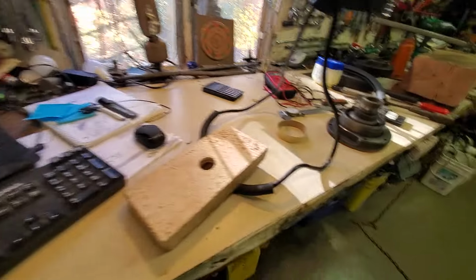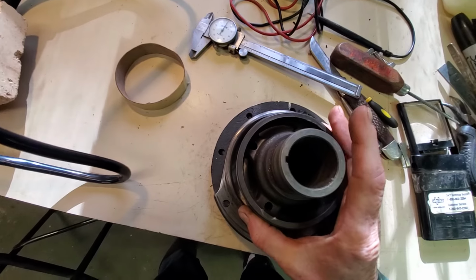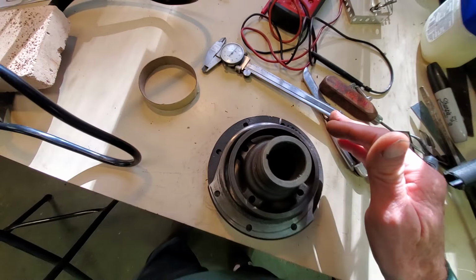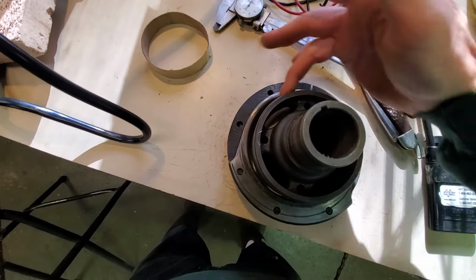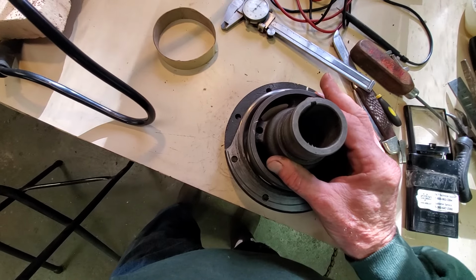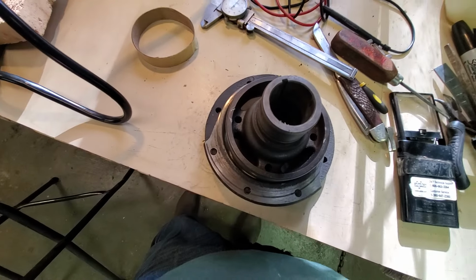Listen, back to our point. So I failed on my first video because of the radiator hose, but I did talk to Damper Dudes. They seem to know everything technical about harmonic balancers and dampeners. And I told them I was getting a gap measurement around the inner hub to the outer inertia ring of 0.100, and they confirmed, yep. They clock the inner hub to the outer ring, set the outer inertia ring on a jig, set the hub on a jig, and then inject the perimeter with the two-part silicone, and when it starts to set up, they bake it.